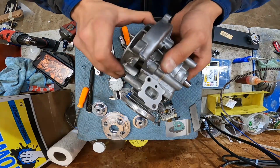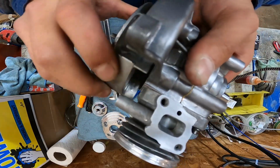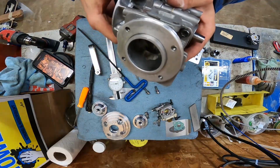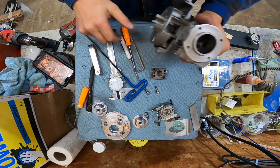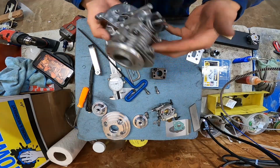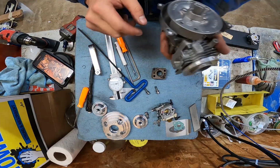I don't know if you can hear it. The piston is hitting the crank. So I gotta pull this apart, cylinder back off of this, find out where it's hitting and trim it, and hope it doesn't hit when this thing's revving to the moon with all the timing. So, is the timing advance key scary with a head kit? Absolutely. Do I want this thing to blow up while I'm on it?